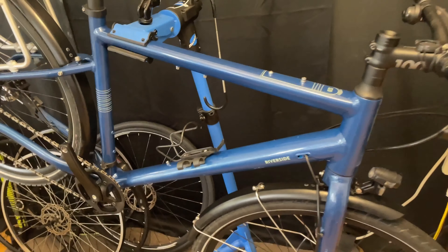I would have preferred to change the rotor but sometimes you just can't. We cleaned up the rear derailleur — went through all the steps: changing the cable, checking the shifter, re-greasing the inside of the housing — and we still have this problem with the last cog. Also the spokes are ripping through the rim, causing the wheel to be wobbly, and there's nothing we can really do about that — the wheel needs to be replaced or at least rebuilt to a new rim. This is a common problem with really big riders. I hope this video helps you diagnose different types of issues on different kinds of bikes.